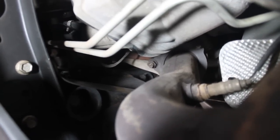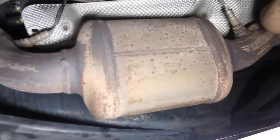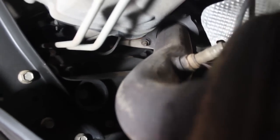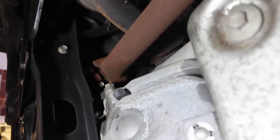So let's take a look under the vehicle. Here we are under the vehicle. Here's the front of the vehicle, the engine, transmission, and right in front of us we have a catalytic converter, and we're looking at the passenger side. On V motors, there's typically two banks of O2 sensors, one for each side. Like an inline motor, there's usually just one bank. And then every modern automotive system has two O2 sensors, one before and one after the catalytic converter.